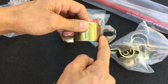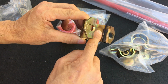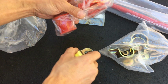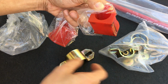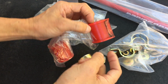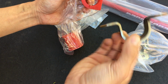You can see a little bit of burntness. Actually, that's just slag. This stuff will chip off, see that it chips off. So that's just from the heat and the carbon from the grease, I think. But you see the bushing there is slightly, just a tad bit melted. That's where it was connected, like so. I think it'll be okay to use like this. I don't think it's going to harm it, but if you want a new bushing, just contact Racing Beat and ask them for a bushing, or maybe even one extra bracket. But this bracket is still good.